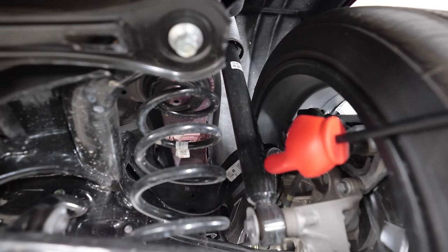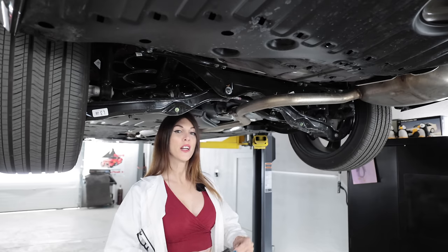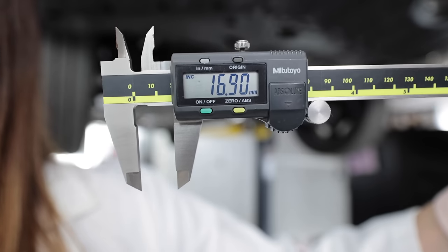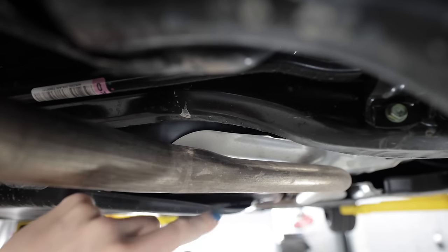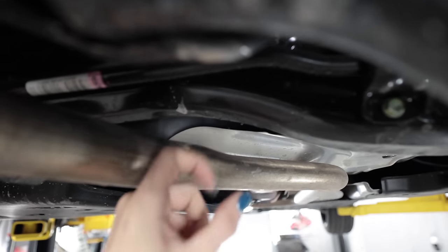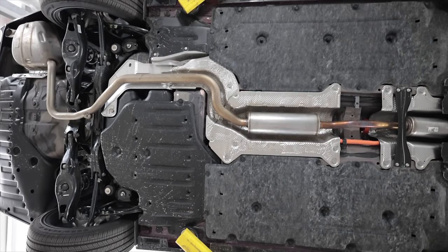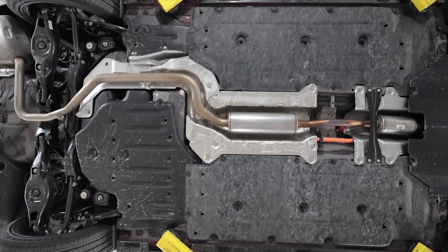Paired with a simple, traditional fixed-rate damper — it looks like it might be Honda-branded. As far as the rear anti-sway bar, she measures in at 16mm in diameter, and it is solid back here. The exhaust piping under the rear subframe gets squished. This new Accord's got a fairly slick, flat floor underneath it. It's a little bit hairier in the center down here than I was expecting.